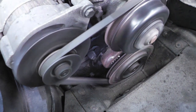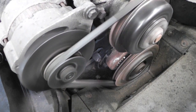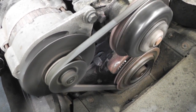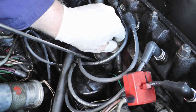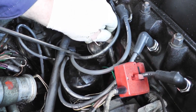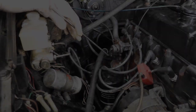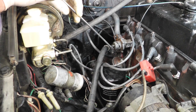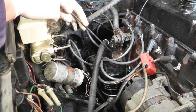I set the timing to 10 degrees — if I put my hand on the distributor I can move it until the two points line up together. When they're aligned the timing is sat at 10 degrees. Now we have the timing set correctly we can tighten up the pinch bolt — I've removed the dipstick just to make access a bit easier; it is quite fiddly. When we tighten that up we can then tighten up the plate bolt round the rear. Finally replace the vacuum pipe and the dipstick, and recheck the ignition timing, making sure it corresponds to the distributor you have. There are so many versions that you must look up what particular timing you need in your manual.